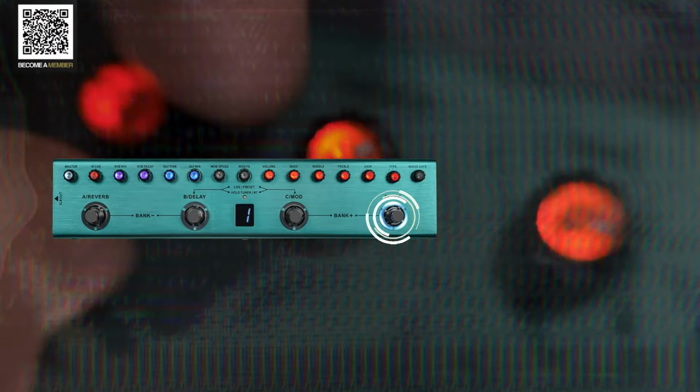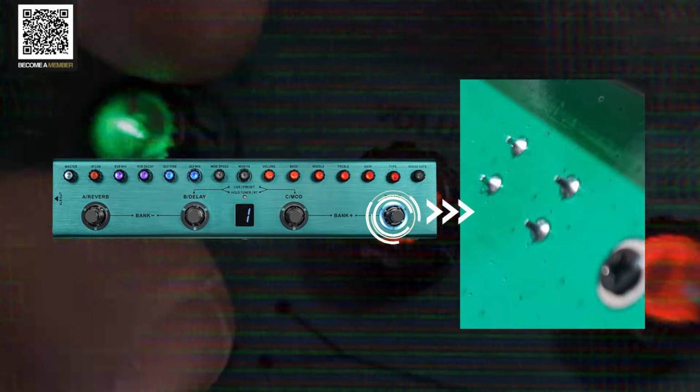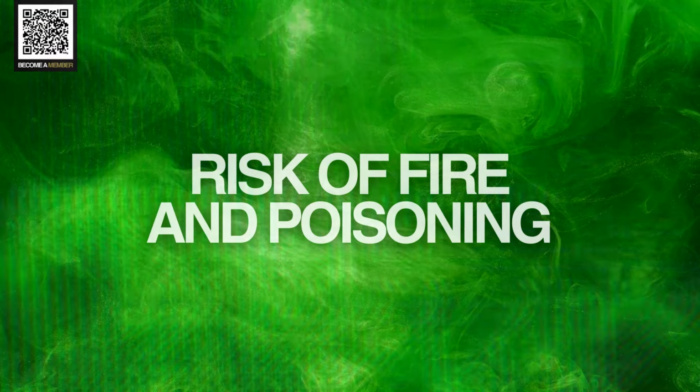After investigation, people found that in all of those cases, the battery of the Tank G was damaged. The damage was caused by the fact that the battery stays exactly under the footswitch of the unit, which creates a physical contact between the footswitch contact tips across the board, and in some cases, physically damages the battery. In the most extreme cases, the battery could even spill, which is a risk of fire and poisoning, as the material contained in those batteries is toxic.